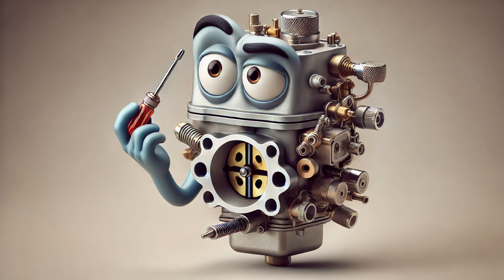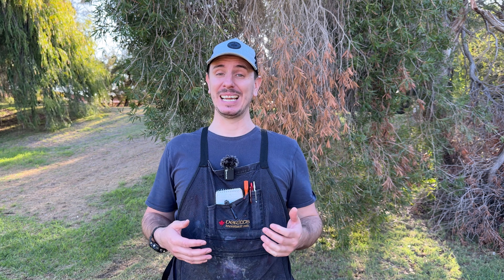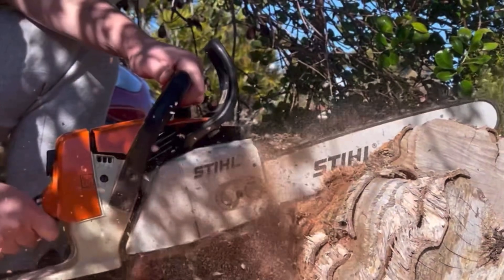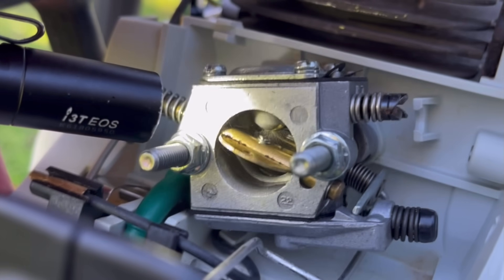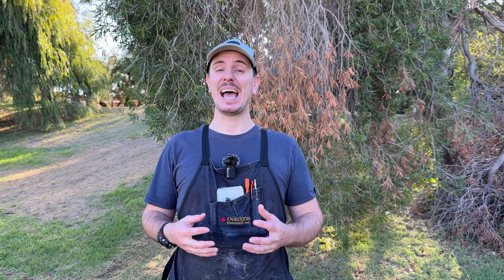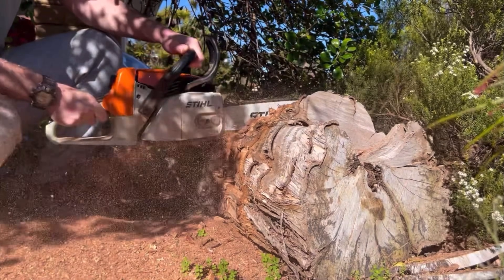The third issue I come across very commonly is what I refer to as carburetor confusion. When an engine doesn't run right it can be incredibly tempting to start adjusting the screws on a carburetor. However, not only does this rarely fix the issue, but if the carburetor does need adjusting, the process is often misunderstood. The screws can be adjusted at the wrong time, the wrong amount, or in the wrong order. This can be compounded by missing other necessary steps like ensuring the crankcase is cleared of any fuel pooling, that the engine is at full operating temperature, that the correct load is applied, and that the butterfly is in the optimal position before setting the low speed screw. Tuning is only effective when everything else is correct — it's rarely ever the first thing you should do.